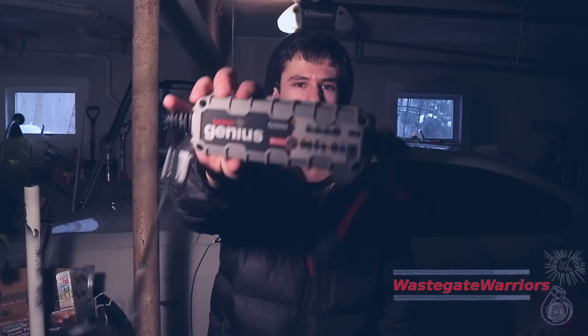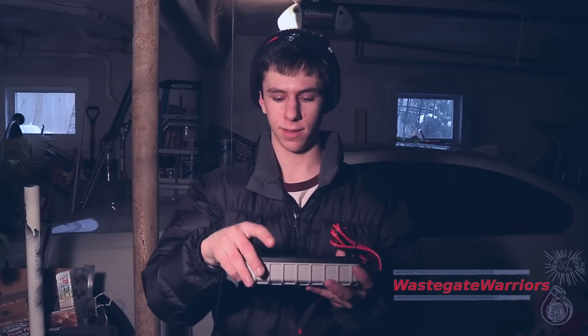You're going to need a couple things to flash your car. The first is a battery charger — ideally 20 amps. This one is nowhere near that, so we're going to hope it works. But I have a pretty healthy battery. You definitely need a battery charger to keep the car charged while flashing.